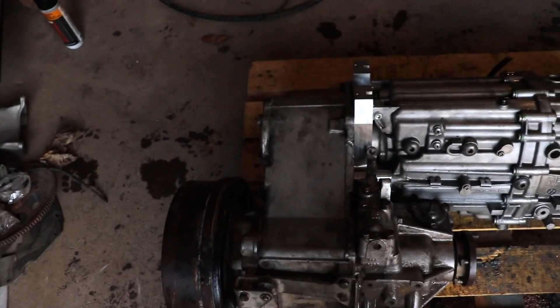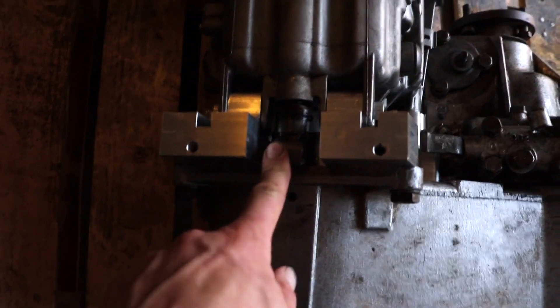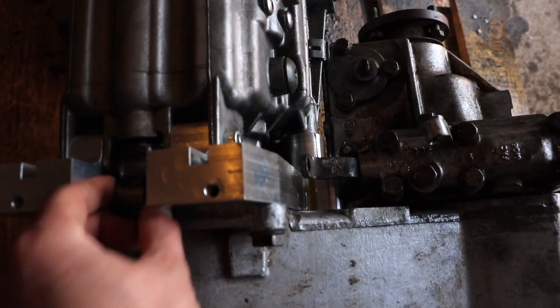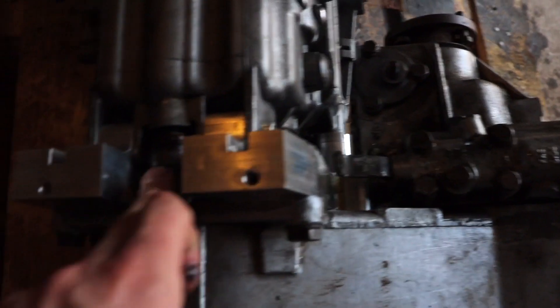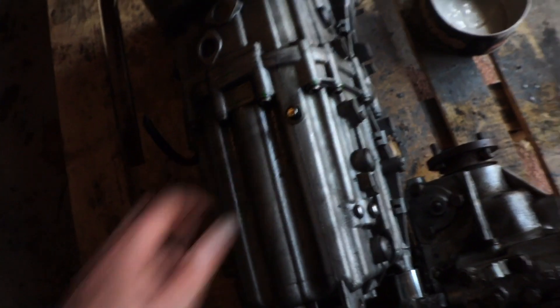So next time I have to put these two together, I will have to take the plate and make a little groove in it, and use Allen key bolts or something like that to make it as low profile as possible. The only job of the bolts there is to pretty much hold the plate in so oil doesn't spill out — it's like a small inspection hole. You can also disconnect the linkage in there. That's pretty much what I've done the last six hours — just connecting those two together. It did take some time. That thing is really heavy and that thing is really heavy, so it's not a lot of fun putting them in place. But now those two are together. That's going to be the total length of the gearbox, which is not that bad — a bit longer than an R380, but not a lot. For the shifter mechanism I'm going to purchase an adapter kit through Syncro gearboxes so I can mount the original Defender gear lever sitting about more center position.